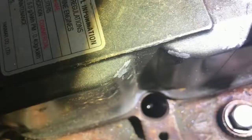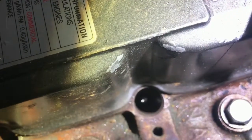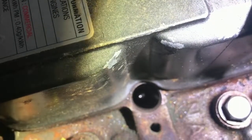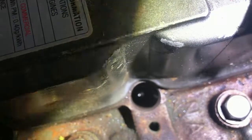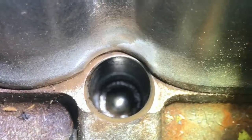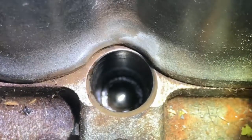...what's to keep the stuff from going down the bottom of the hole into the cylinder itself? Well, what we did after we got the injectors out is we dropped a ball bearing down on the bottom to keep the crap and stuff from going inside the cylinder. You can see the ball bearing right at the bottom — we've got all the crap off the inside of the hole. Just works fine.